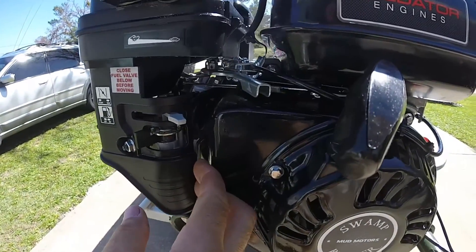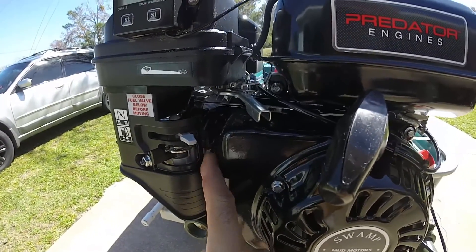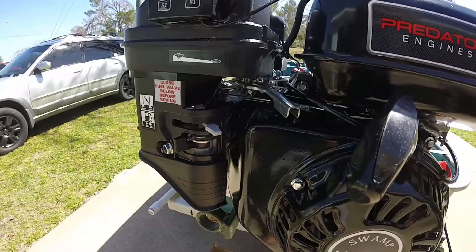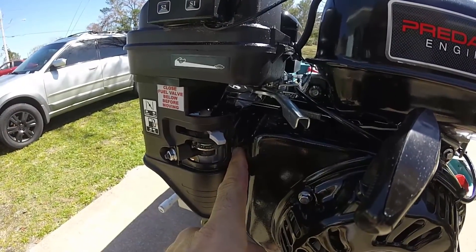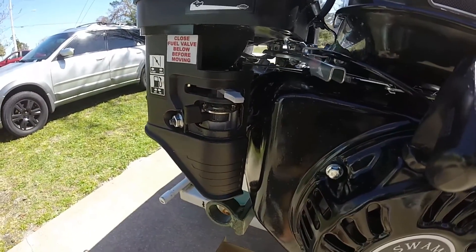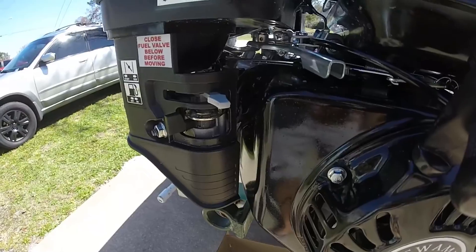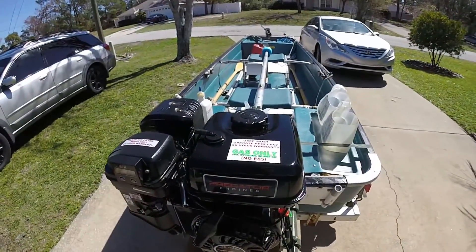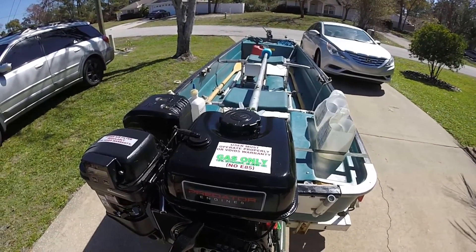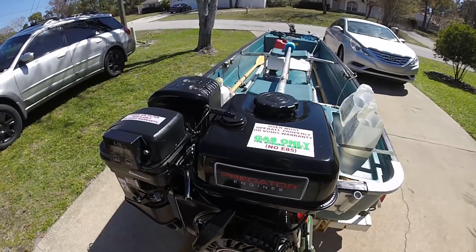Find the side of the carburetor — in my case it's right here — that's where the fuel line comes out of the gas tank and into the carburetor. Note that it is on the opposite side of the fuel shutoff switch, so there's going to be fuel spilling out as soon as you disconnect it. Be prepared with your container to catch the fuel. Also when draining your fuel, be sure to remove your gas cap to help the fuel drain out faster. Don't remove the cap until you have your line disconnected, otherwise the fuel will flow out a lot faster while you're trying to disconnect it.